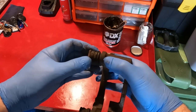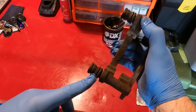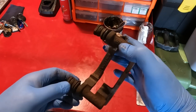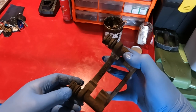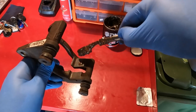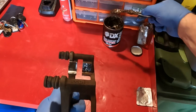It's a really good opportunity to check that these sliders do exactly that — slide. There is a special silicone lubricant you can use on these pins if necessary. I've checked these and they've got plenty of lubricant and they slide beautifully. It's always best to be careful with brakes — it's a very bad idea to use any greases or lubricants not designed for braking components, as they need to be high melting point and must not end up on your brake linings or discs. I'm now going to apply some copper slip to the pad contact surfaces to ensure the brake pads can slide freely.